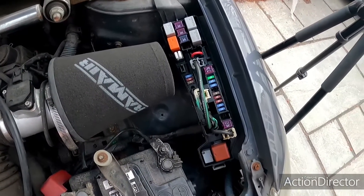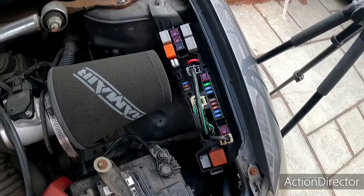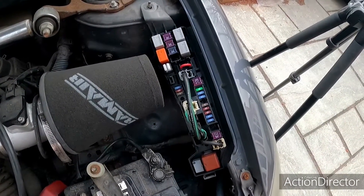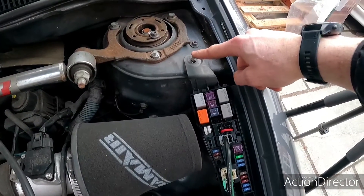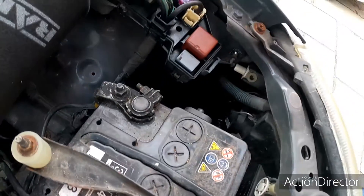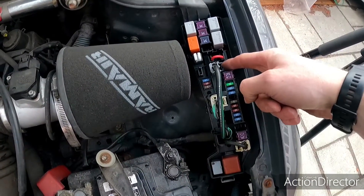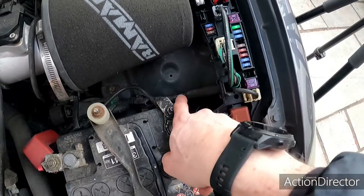It's not a simple task of taking the fuse out and replacing it - you've got to take the main fuse box out and replace it that way. It's not the sort of video I wanted to be doing, but I need to do it anyway. I've got the fuse on order, it's not here yet, but this will at least show you how to gain access to it and how to change it once you do get it. First things first, I've taken the cover off. There's a nut here and another nut just here which I've already taken off - that just makes the fuse box itself loose. And then there's this cable here.